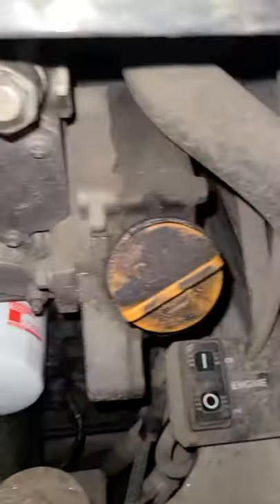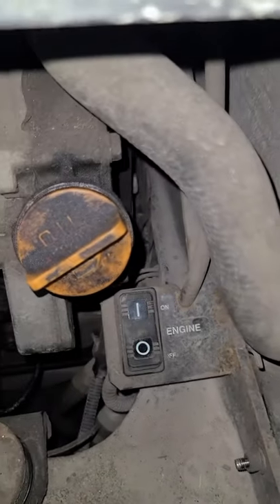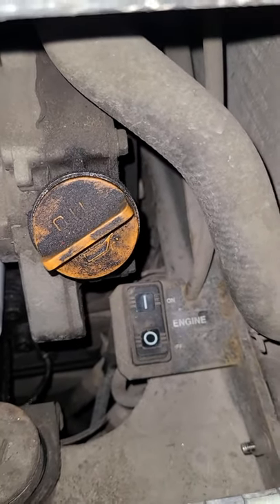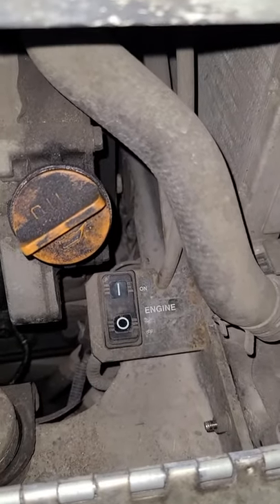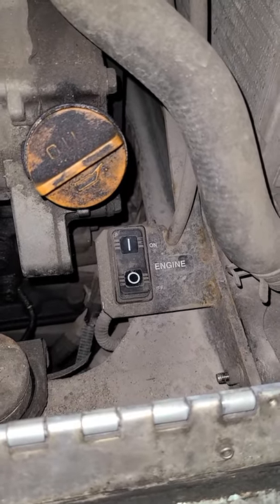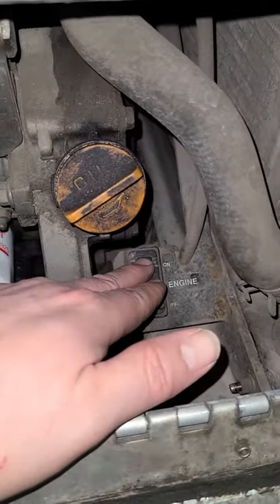The second thing to cover out here is the power switch for the APU. If this switch is flipped off, the APU is not going to work; flip it back on and it will operate. There have been a few times drivers went days without an APU only to find out the switch was off. Sometimes at shipyards they'll flip it off because they don't like the noise, or at a shop they'll flip it off to avoid exhaust fumes inside — and then don't mention it. So if you have trouble getting your APU started, make sure that switch is on.